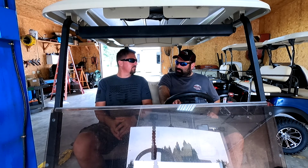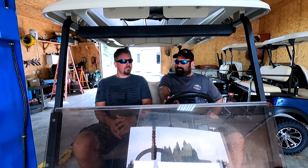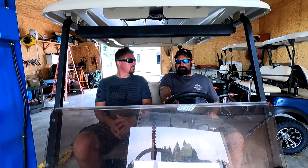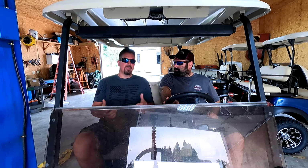Yeah. One of the big things I really like about these is that there's no maintenance. On a lead acid battery, every month or every 6 to 8 weeks, depending on how much you charge them, you have to check the water level, and then you have to add distilled water, and then sometimes people overfill them and they leak onto your floor and rot away the concrete in your garage. Just messy maintenance. And the fire hazard for a lithium iron phosphate battery is very low.